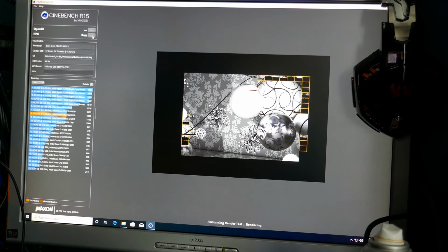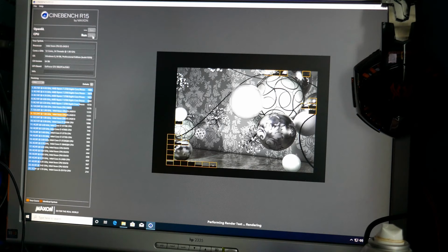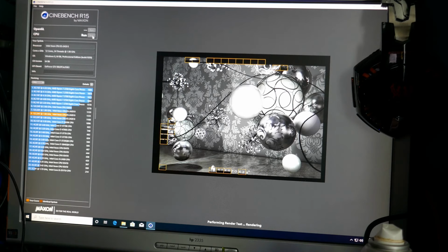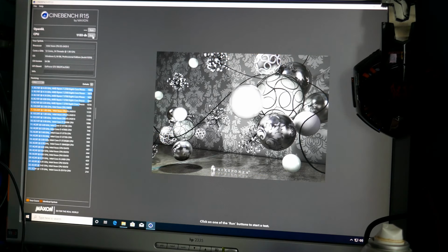I'm looking at the list of Xeon chips, and it looks like the fastest clock speed processor, they have two of them. The fastest clock speed they had was 2.5 GHz. They have that both in 6 and 8 core. The 10 core was 2.4 gigahertz. And we're 1133 again. So that caching thing I enabled in the BIOS didn't make one diddly squat of difference, but it didn't hurt anything either, so we'll leave it.